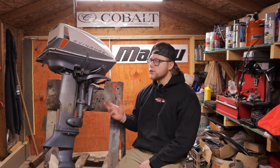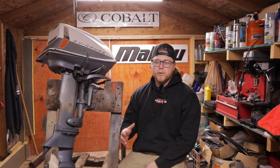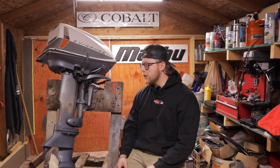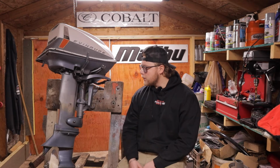Once he's on the water under a load, it seems to bog out, and I have an idea of what it is, but I'm going to show you guys how to diagnose everything on it, go through the whole system and see what you're really looking for, because it's pretty much the same process. Obviously, when you have different symptoms, you can diagnose it quicker if you see it a lot, but this video will be going through everything on this motor, including compression, fuel system, timing, spark, the whole nine. And once we get her diagnosed, we will order some parts and repair it for this gentleman.